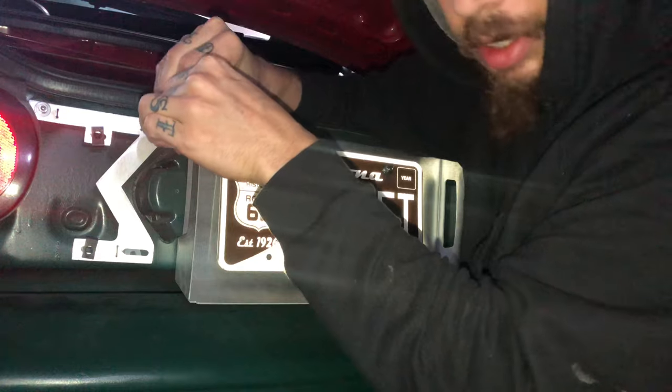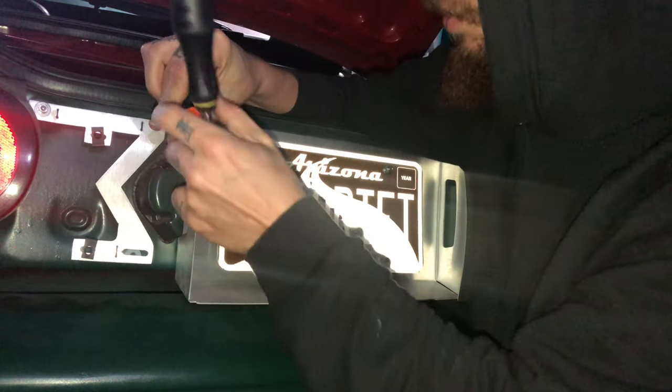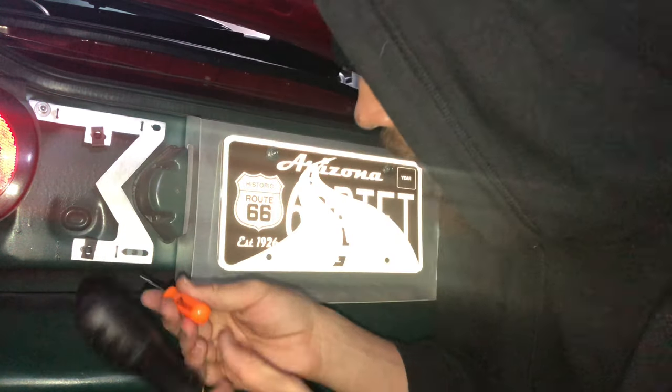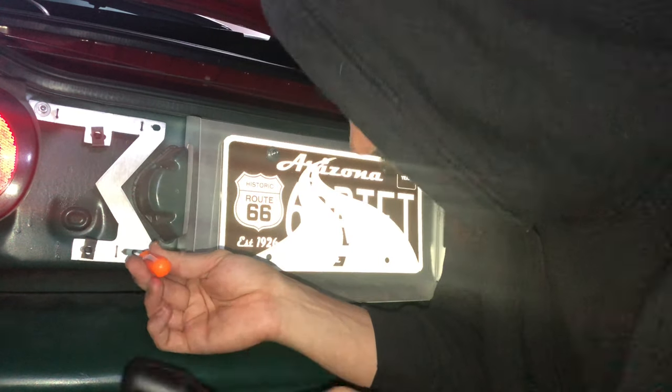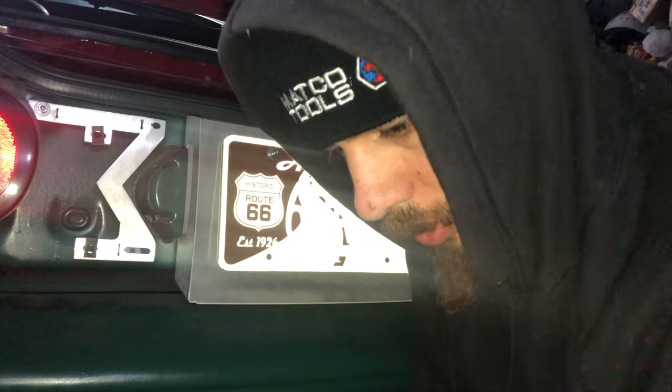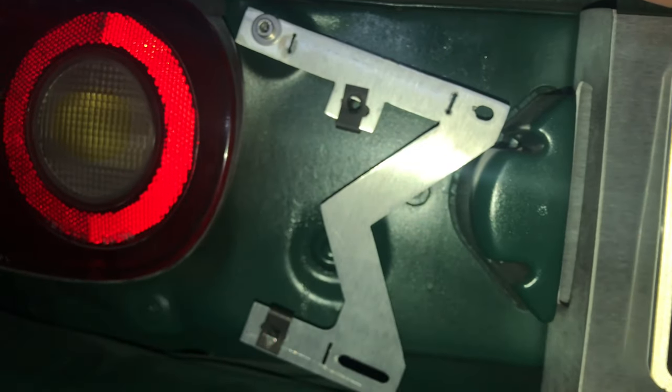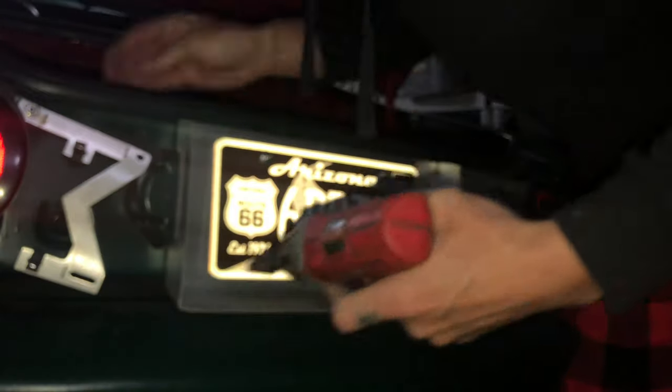I know that's not super scientific but it'll work — trust me. Stick this in the center of the hole the best you can, hold it in place, and take something to put a little dot on the other side. Do the same for this one — in the middle of the hole. Take this and move it downward. There's that little pilot dot and the other one right here — a little red mark. Now take the drill with a taper bit and use just the top on our pilot hole. Don't push too hard because I actually pushed in some of the sheet metal a little bit — we want to be careful not to do that because it will cause warping.